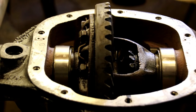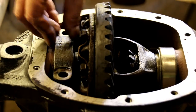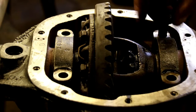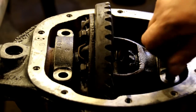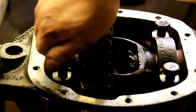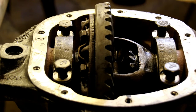It's time to put the caps down. These have to go back in the exact same position they came out — we've got our two prick marks here and two there, so we match them up accordingly. Remember, if you turn them around or get them in the wrong location it's not going to work well. Everything was machined as a unit, so they have to go back the exact same way. These caps get torqued to 50 foot pounds. We'll torque all four, then come back with the dial indicator and see what we have for backlash.